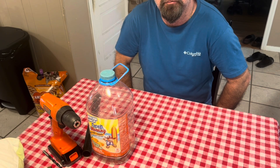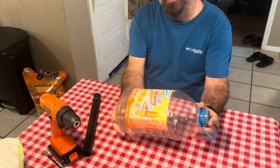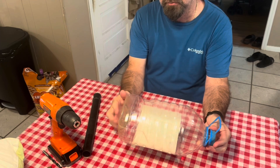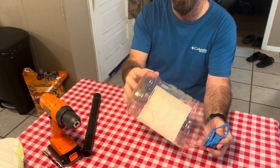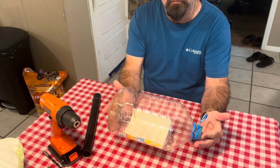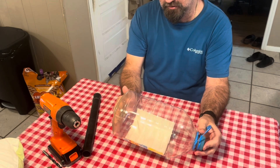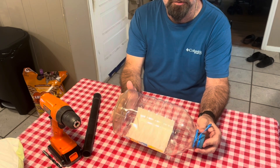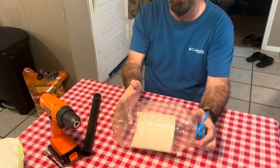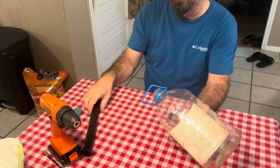This is what you need to make a filter. I'm gonna drill some holes in the back of this — it's a plastic fruit jug, and I use it because it's sturdy. I'm gonna put some holes in it at the end and fill the inside with polyfill from an old pillow. There's only three parts to it: you got the jug, the polyfill, and the hose attachment.